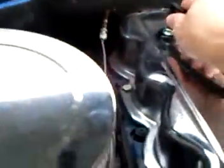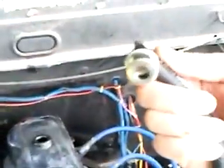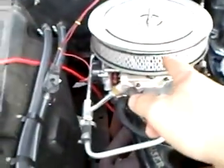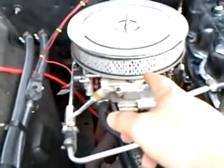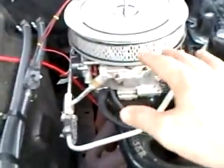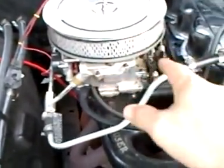This PCV valve — you can see the oil just sitting in there, wide open. But it gets good vacuum — I checked it and it's pulling vacuum out of there, so it is working. I also want to do my own air cleaner. Those will probably be my next two projects — probably the air cleaner first since that'll be a little easier, and then the valve cover, which I'm not quite sure how I'm going to do yet.